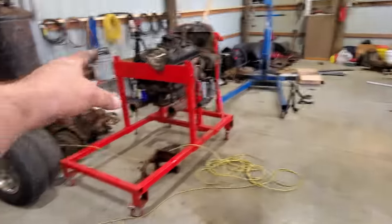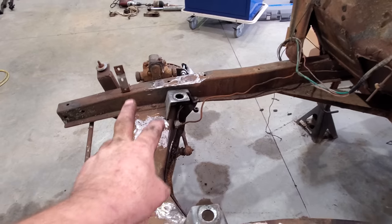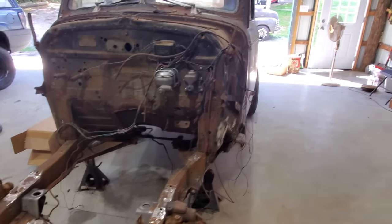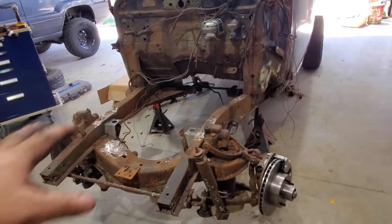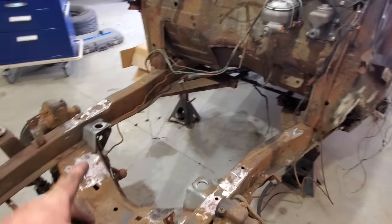Well, I gotta get the transmission bell housing on it first. Then the motor mounts. You know, the old one was mounted on the front, like the Tri-5s do. Then they had it mounted on the back of the transmission. That ain't no good. It was like that when Daddy first put that motor in it, and we was breaking transmission mounts. That's when he did the bell housing mounts, solved that problem.